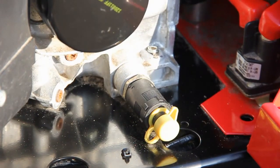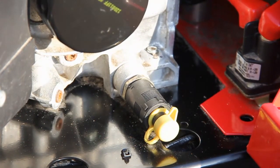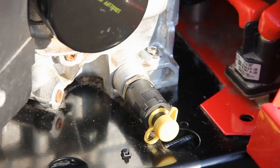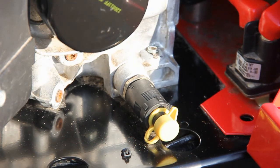The type of drain plug you might have may vary depending on your lawn mower. Some will have a bolt on the end which you can unscrew, and others will just have a little plug on the end with a neck which you pull back, put a pipe on the end, and then the oil will drain. This is usually on the more modern engines.